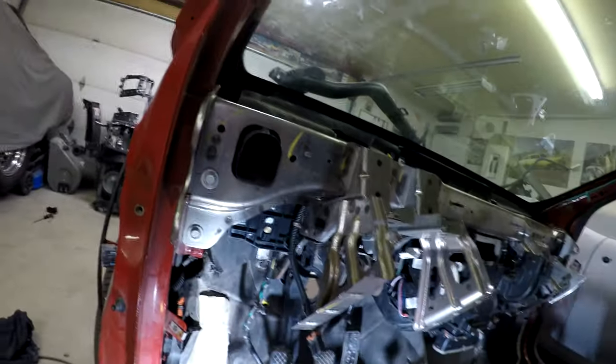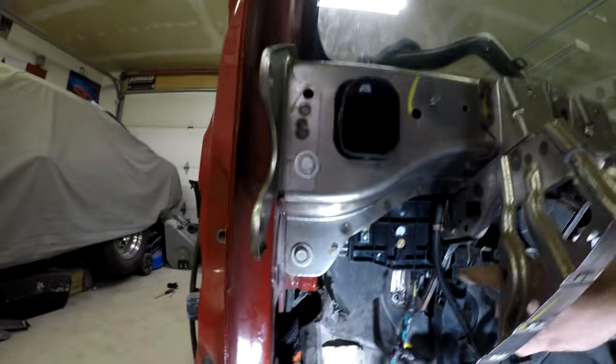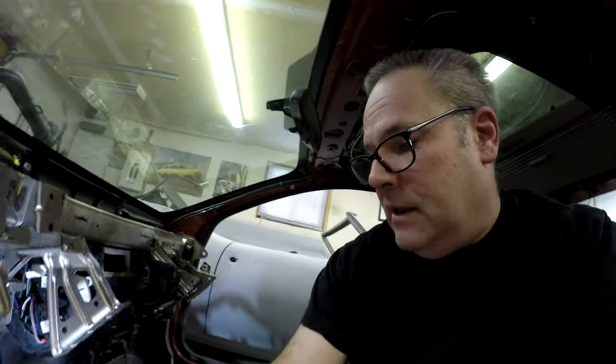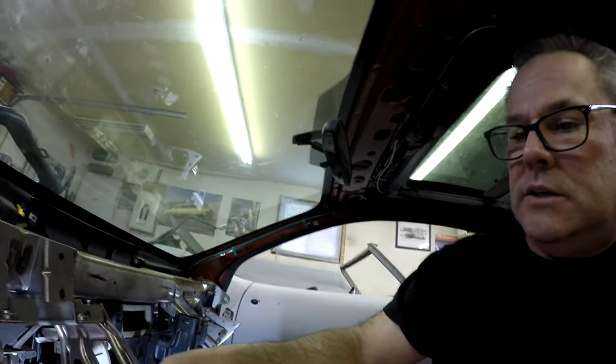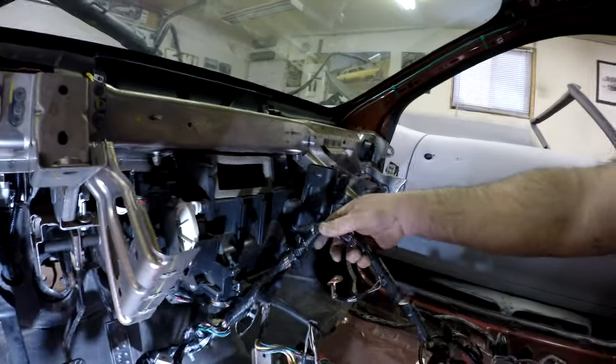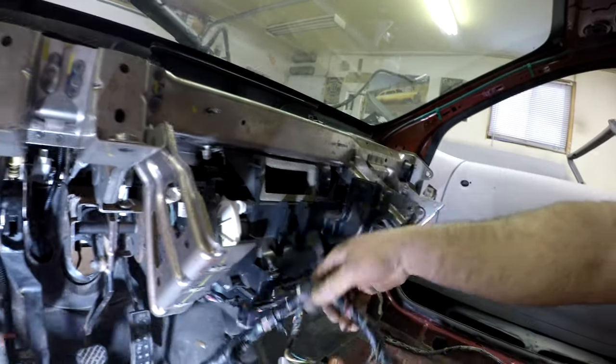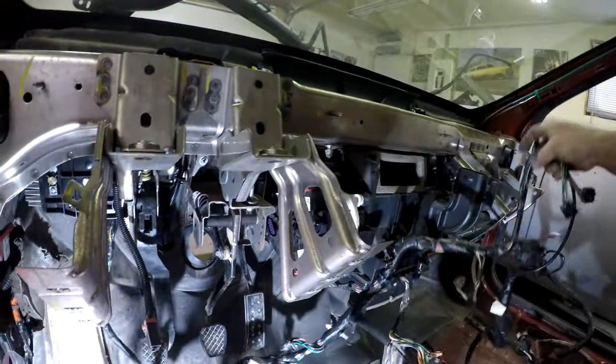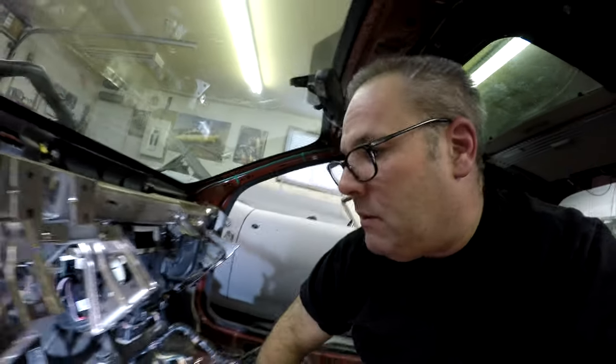So the next thing I guess I gotta do is put the wiring in, all that wiring, and then I can put the plastic dash top on. The steering column can go back in. So let's start putting this wiring harness in. Back there, that black bracket - I guess that's an amplifier for the Pioneer system that these cars come with. So I put that in first. Now I basically just have to remember how everything here fits in place. There are grounds there - we know the grounds go on this little nublet here. So that's a good starting point.